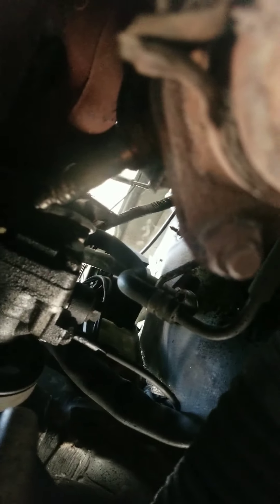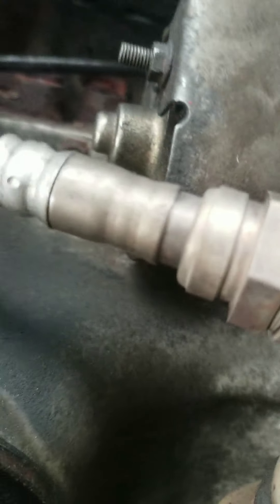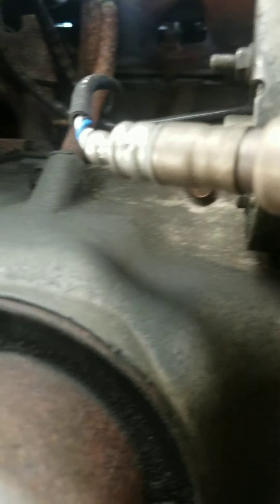As you can see, he had already changed both his O2 sensors — this one down there and the one up there. He changed out both of those. So we're getting ready to finish changing this out, and that should solve his problem with his exhaust. He changed this O2 sensor and then the other one upstream. When you've changed them all and you still have problems, obviously the problem isn't the O2 sensors — it's the cat. That's why we're getting ready to change it.